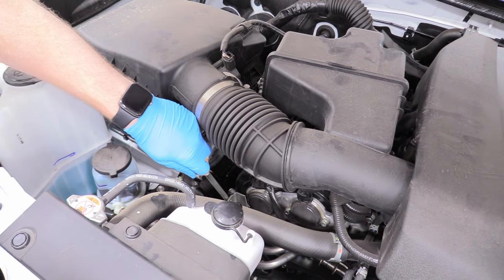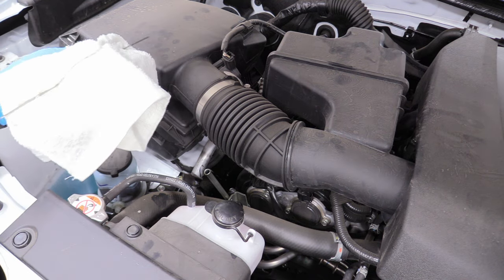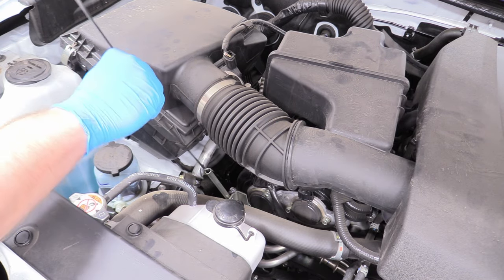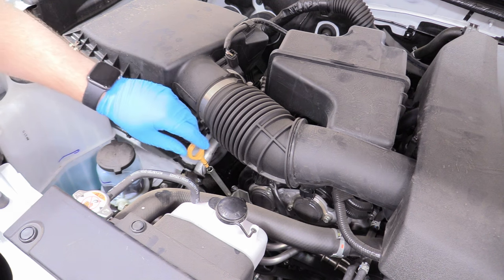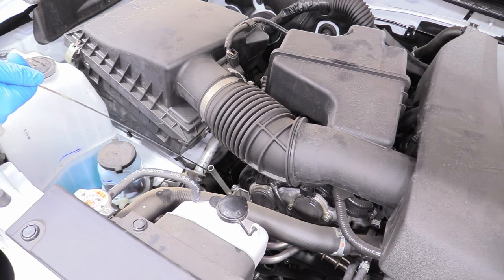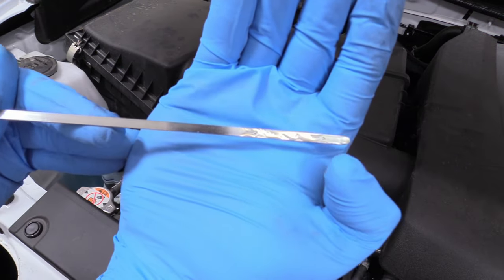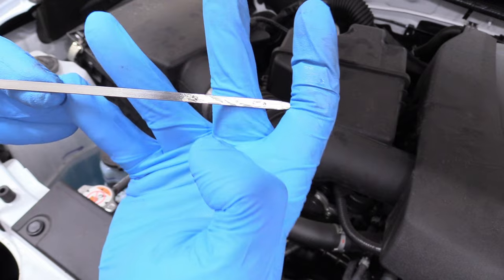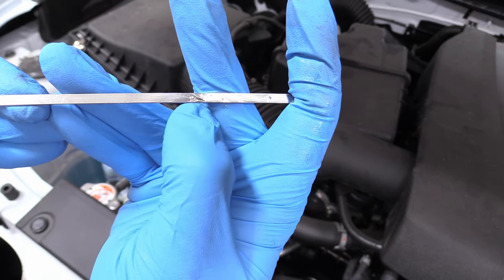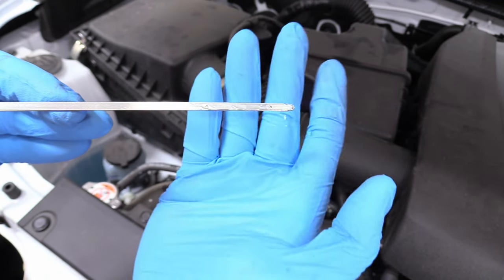Start the engine and let it run for about 45 seconds just to be sure the oil is getting everywhere it needs to go, then check the level to be double sure. While it's running, make sure it's actually building oil pressure — if it's not, you've probably mucked something up with the filter. Wait about 30 seconds to a minute to let the oil fall back down into the pan for an accurate reading, making sure the oil filter and oil cooler are full. It's a good idea to look underneath the vehicle to make sure it's not gushing oil. Pull out the oil dipstick, wipe it off, plunge it all the way down, bring it up and check the level. It's right just a hair above the second dot, which is totally fine — six quarts is good.